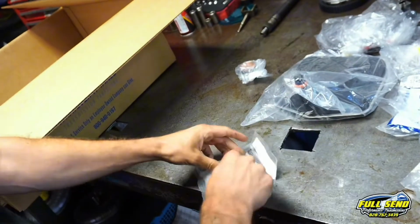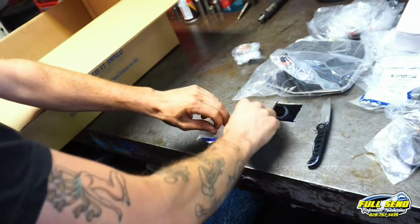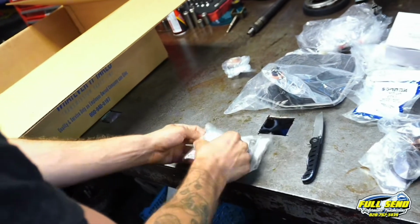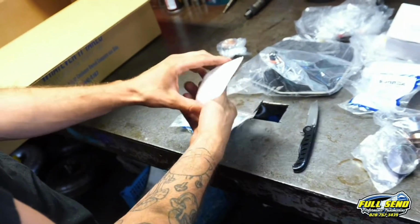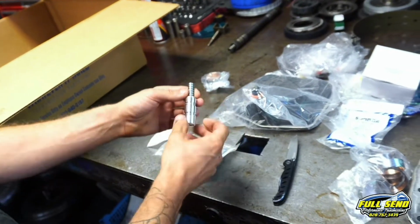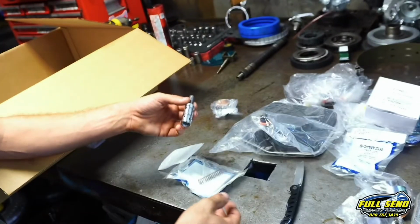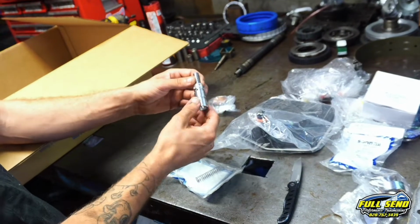I know you can't see it, so I'll go ahead and cut it open for you. This right here is what's causing all these 700s to fail. This plunger valve inside of the valve body. I've had 4 or 5 trucks come in here. You put it into drive and the vehicle stack shifts first through fourth. You go back in and put a brand new performance plunger valve.